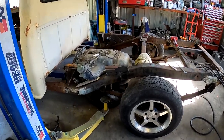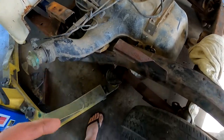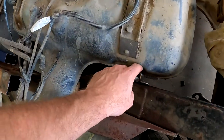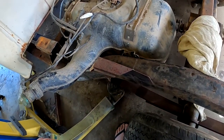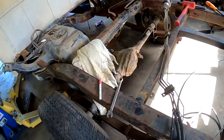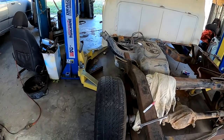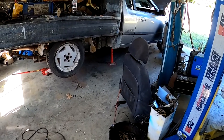The GoPro died there but I've got the Holden fuel tank removed. I had to clearance that bracket for the BA fuel tank - I pulled one of the fuel tank brackets out of the Falcon, that one unbolts, and the other one I had to drill out the spot welds. I'll remove the sections where it mounts up to as well - just trying to utilize as much of the factory stuff as I can. I think the tank's going to work where it is, probably just got to fettle around the position a little bit.